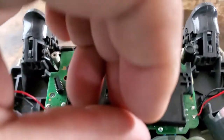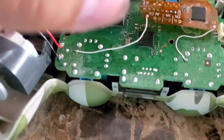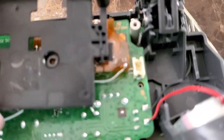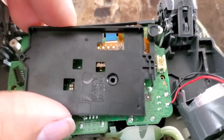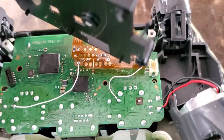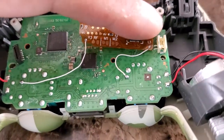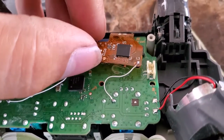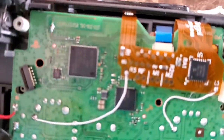So the plate — as soon as you finish your work, you drop it in the hole. The flex right here is in the way of the hole, so all you have to do is line it up like that, screw it back in. And since you cut off that little post, it's not gonna be in the way of this hole. Let me move it around so you can see — right there, it's not gonna be in the way.